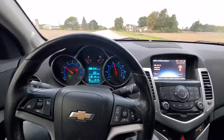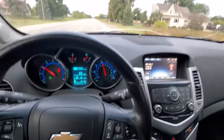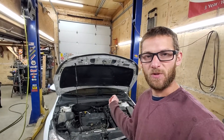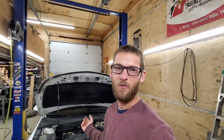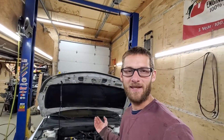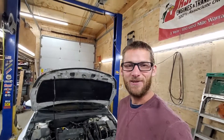I took it for a spin - it wasn't fair to just say 'it's fixed' without verifying. She's all good. We got a new thermostat in because it had a bad thermostat heater. We also replaced the purge valve that was opening and leaking, causing a vacuum leak which was making the car stall when coming to a stop, and sometimes the car would die out. That's resolved too. Thanks for watching - if you wouldn't mind liking, commenting, or subscribing it helps the channel grow. Catch you on the next one.